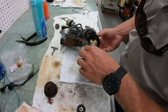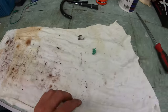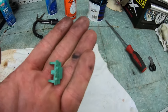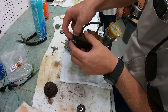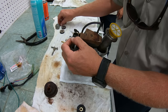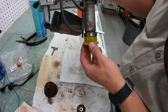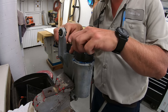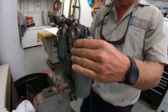Put this little plastic piece on and then don't forget this other little spacer piece before hooking up the pump and pushing it back into the top of the VST. It's also really important that you don't forget this little green piece that goes onto the clip, or else you will have to take the tank back apart and put it on. Now just place the little spring back on the float with the needle on the spring and tighten the screws back down. We now have the assembly back together and ready to put back onto the tank. We'll take the gasket and using grease to hold it in place, set the gasket and then carefully drop the top of the tank back in place and screw the top back on with all the screws.